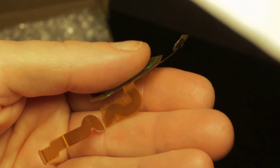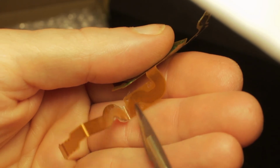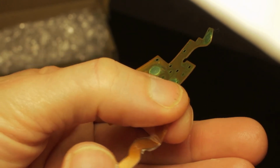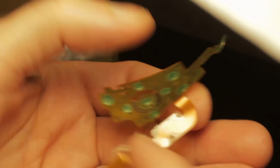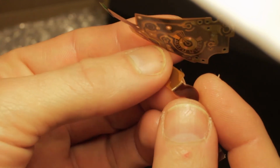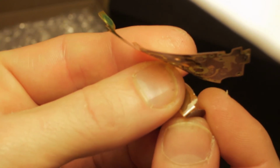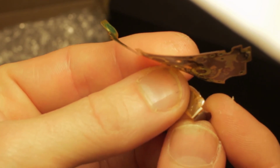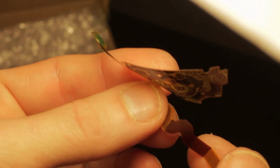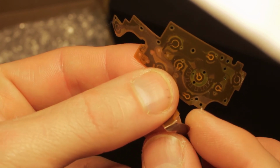And right in this crease here, you can see where it looks a little bit pale. This is where the plastic, the adhesive plastic, has lifted, and it looks completely intact, and it is actually intact in the sense that it's not pulling away. But the break occurred, if I turn that over, you can actually see right there. Now hopefully this is going to be much more visible than it is on my little screen, but if I peel that away, you can see where the actual cable and the contacts are. It's snapped right there, which is obviously just from bending, from flexing, straightening and flexing, straightening and flexing, which is clearly not good for it over a long period of time, and obviously if it's been sat there for a while. And it's just started to snap along there.